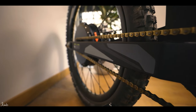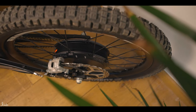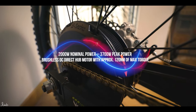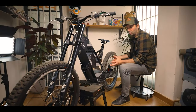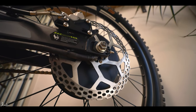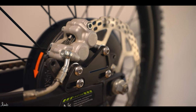The pedals are chain driven going back to the rear crank. The rear hub motor is a DC series brushless motor — 2000 watt nominal power and 3700 watt peak power, so it's pretty powerful. If we compare that to scooters, that would be like having 1000 watts front and 1000 watts rear, so you'd expect it to be hitting 35 to 40 miles per hour. Really high quality motor. We've also got the huge rear disc with the four-piston Mini Cross 65 brakes which we spoke about earlier.